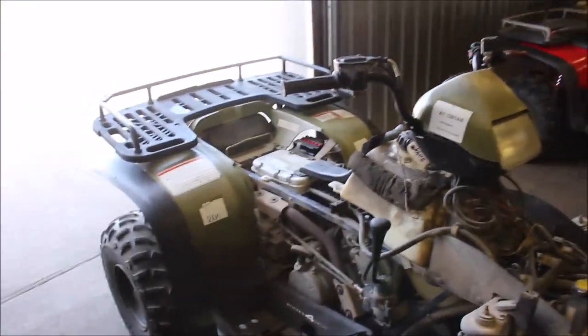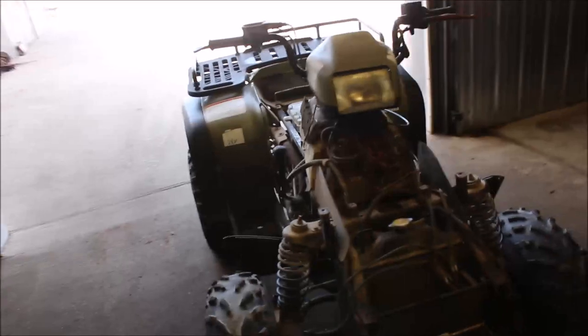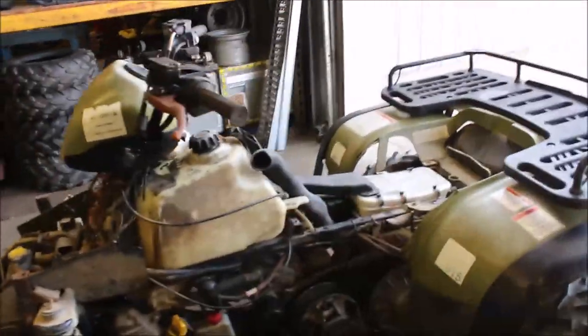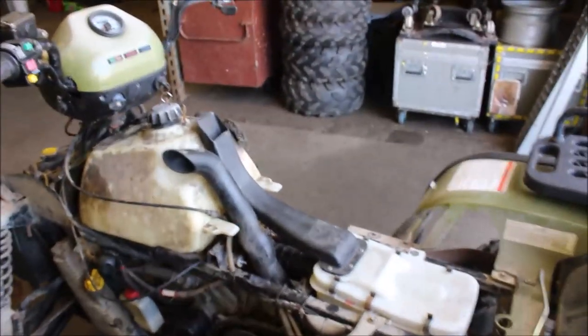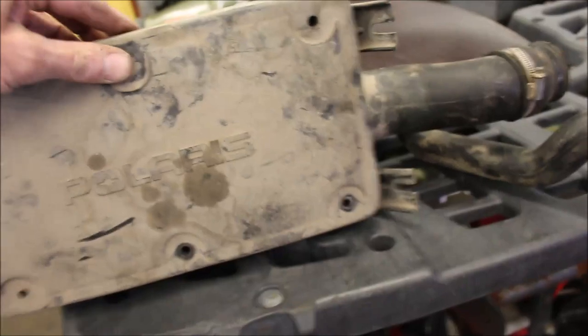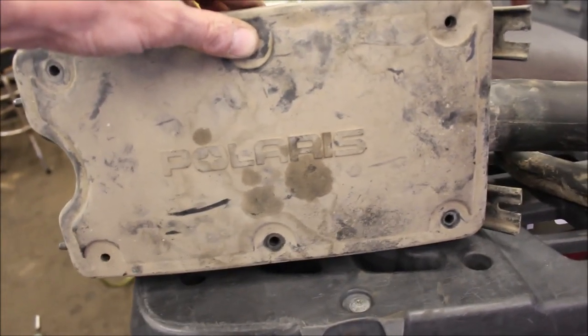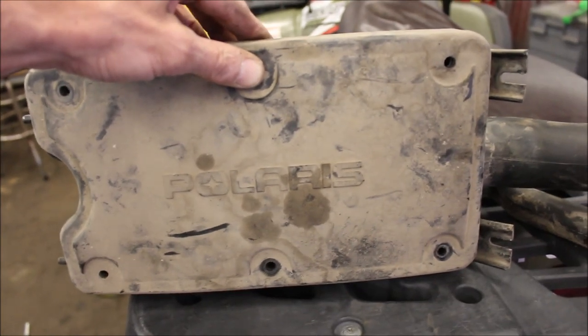Here you have it folks. Runs good with the airbox off, runs like crap with the airbox on — here's your fix. Just need a sealed airbox. Now what you could do — and I've done this before — if you didn't want to spend the money on an airbox, make sure it's cleaned out really good, put a brand new air filter on, put the cover on, and you can actually use some kind of caulk or sealer. Put some zip ties around it, make sure it's sealed off tight — silicone, whatever. It'll be a pain when you've got to replace your filter, but that could save you some money and cure your problem.